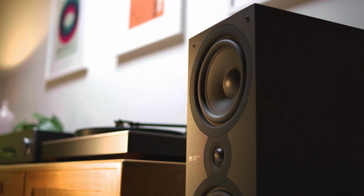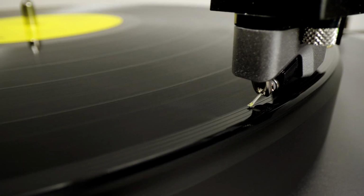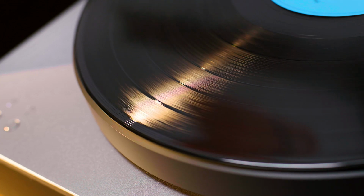The Alva Phono cartridge is designed to give you approximately 1,000 hours of listening pleasure, depending on the condition of your records. But there will come a time when performance drops off and it's going to need replacing. Excessive wear can be detected as a duller noise or stereo imbalance, and this can be difficult to spot as it builds up over time, so you're probably better off working out an approximate weekly or monthly usage and going from there.